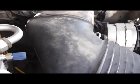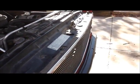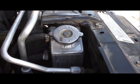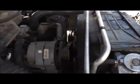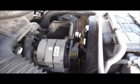And you can't see it because of this air intake setup, which I guess was a factory deal on these. But down there on the manifold, there is a crack in this manifold which needs to be replaced. I do have a big 3-core aluminum radiator on this with the factory style 180 degree thermostat.